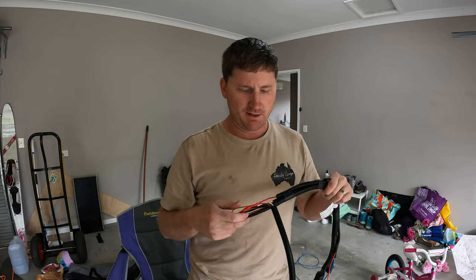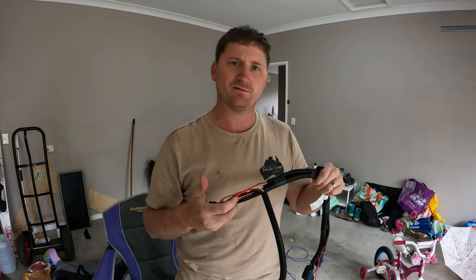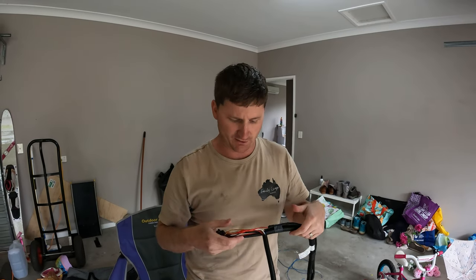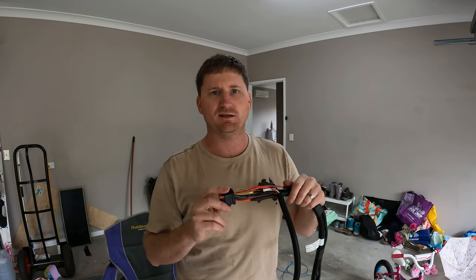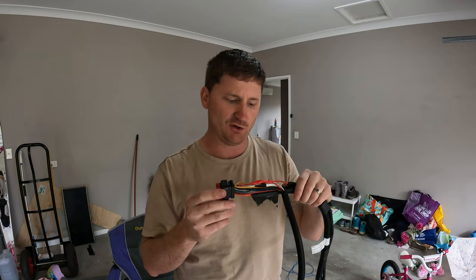So what I've done so far: I'm in the process of installing the trailer plug on the car and I'm doing the brake control at the same time. I've made a bundle - the brake pickup and the electric brakes are running as a pair down the side of the car. I did this on the Prado and it worked really well, because some cars now have problems. There's an ECU in the back of the 79 with the factory tow harness, so all I've done is tapped into the brake signal wire at the back of the ECU, which runs straight down to the trailer plug.